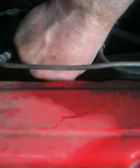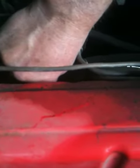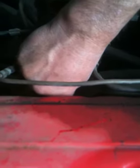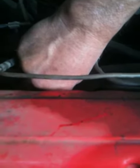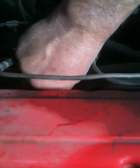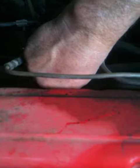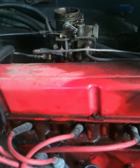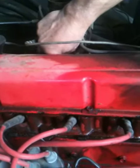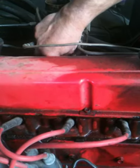So I bring it back out. As I bring it out slowly, the engine starts to run smoother and more even. If I go too far the other way, the same thing happens again — the engine starts to run rough and uneven. Now it is running too rich. So what I've got to do is find an even balance between those two settings.